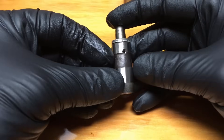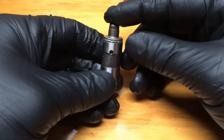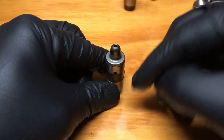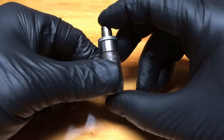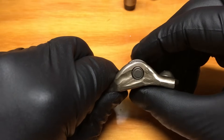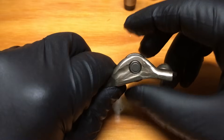You might find a new one that feels worse than your old one and think something's wrong. What you need to do with new lash adjusters is put them in a bath of oil — submerged above the fill hole — and let them pressurize and pump up. After that they'll hold just like a known-good used unit. These are really important items to check. When the lash adjusters fail like this and flop around, they will damage the camshafts, which run about three to five hundred dollars apiece.